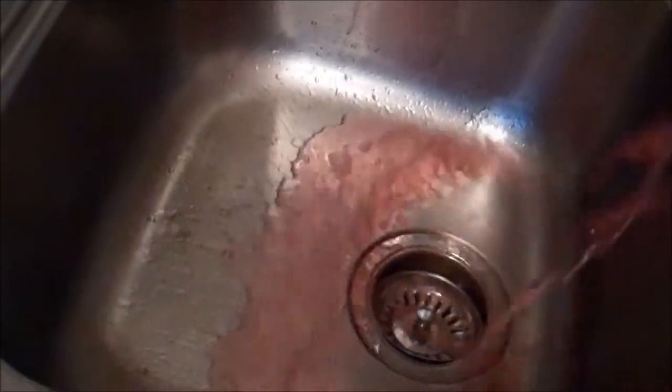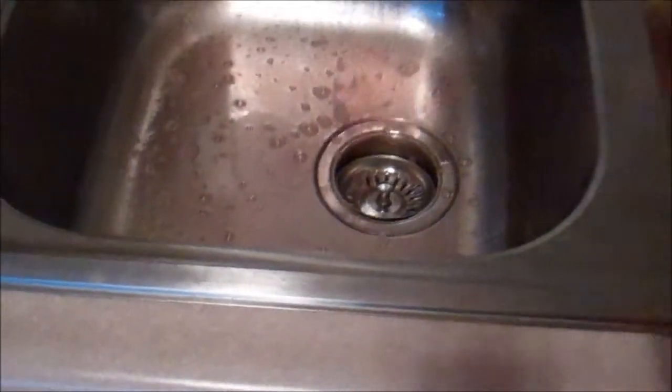Next, you start just dumping the antifreeze down the drain lines. Maybe a quart or two per. And then I put about maybe a couple of cups in the dishwasher. That comes out the drain line you open, so don't get too carried away with it. But you do that to all the sinks.